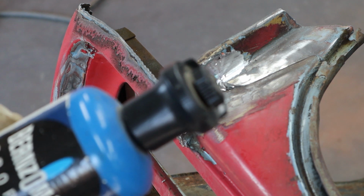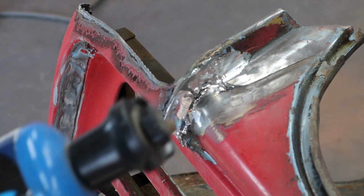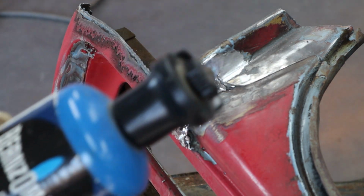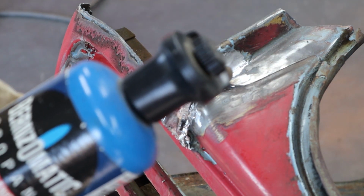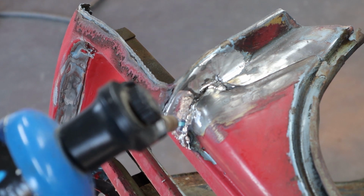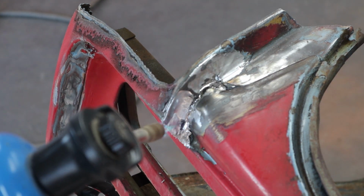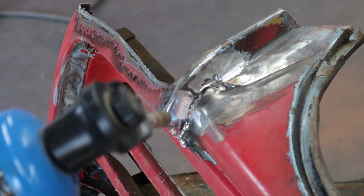But we still have to find those spot welds. That solder or that leading is not holding this together structural wise. It's more like a body filler. But it will impede you from getting your spot welds cut apart. I gotta drip that out right there.